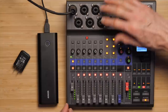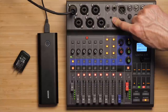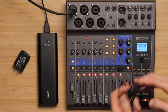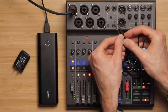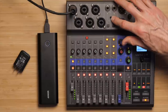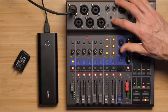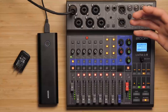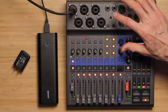In addition to the six-microphone input, you also have a 3.5-millimeter TRRS input here. This is for feeding audio from your mobile phone into the LiveTrack L8, and it comes with the necessary cable — a 3.5-millimeter TRRS cable — which is nice, so you don't have to go searching around for one. Not only can you feed audio from your phone, but for example, if you wanted to play some prerecorded music of your own making or you wanted to Skype somebody and bring a remote host in onto your podcast, you can do that here.